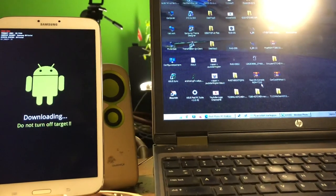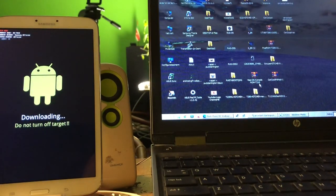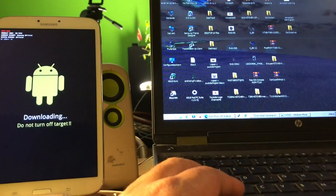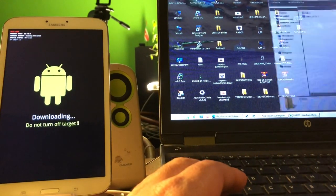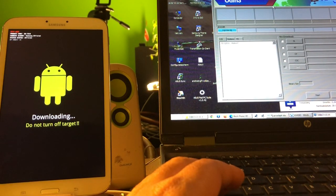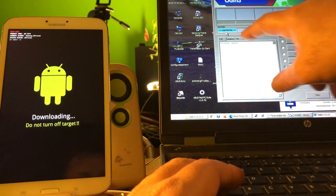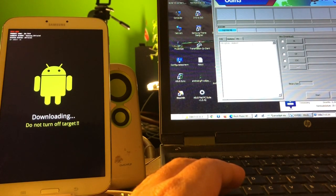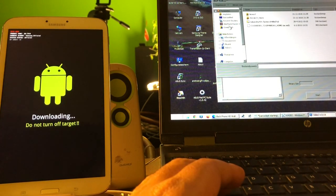Cable is key — if you don't have a good cable you can brick the tablet very badly. I'm going to use Odin 3.11. Starting it up, we can see the COM port is lit up in blue here — the others are off — meaning the tablet is recognized by the PC. Now we can scroll for the TWRP file to install it. We're going to hit AP and go to my downloads.